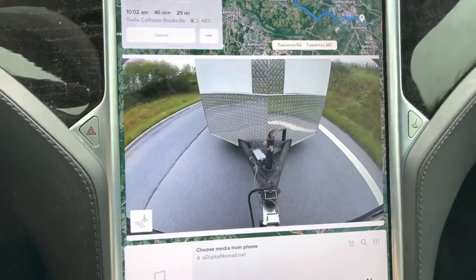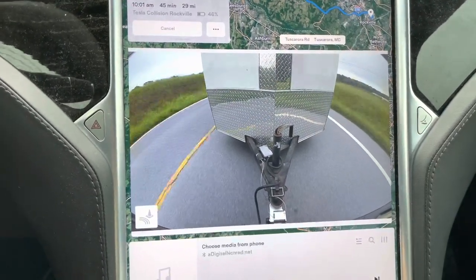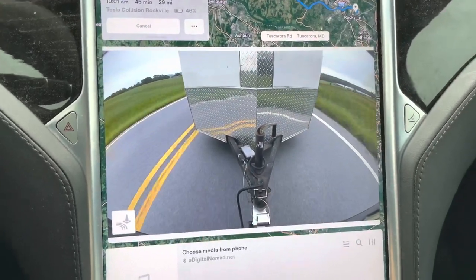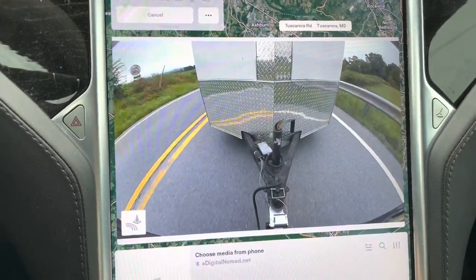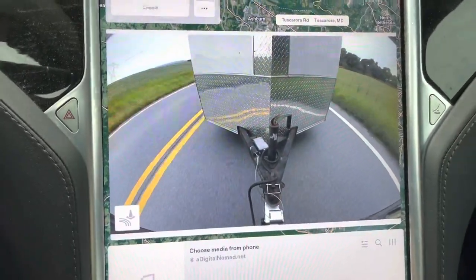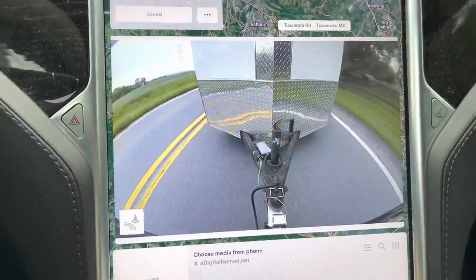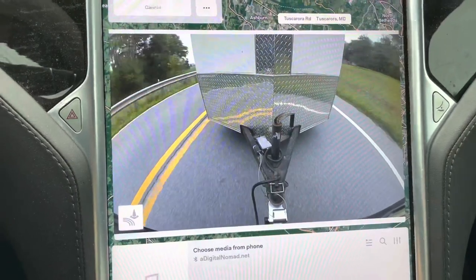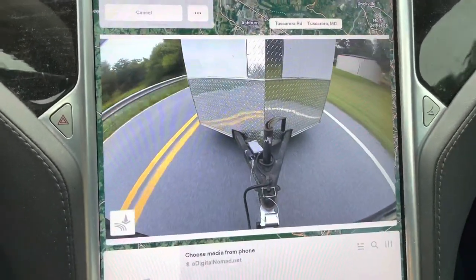I don't think it's the rear suspension — I would think I'd hear that regardless of whether the trailer is on there or not. Even when we've had a lot of weight in the car, it's never happened. It's the same thing regardless of speed, and if I hit bumps and it twists the hitch, it does that too. I'm thinking mounting bolts — wherever it's mounted on the frame, those pieces could be cracked or loose.